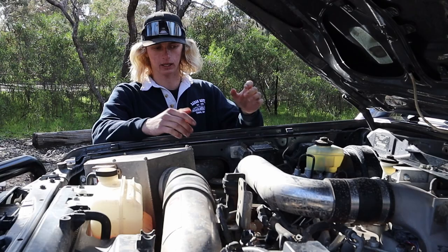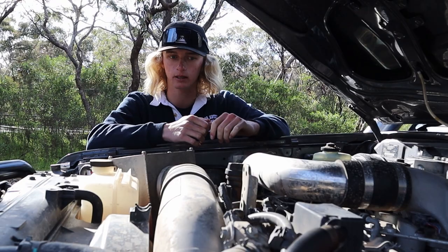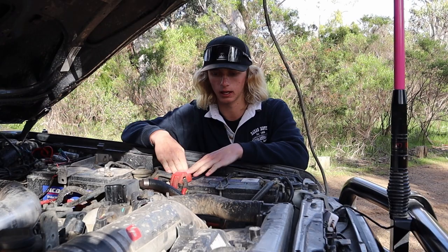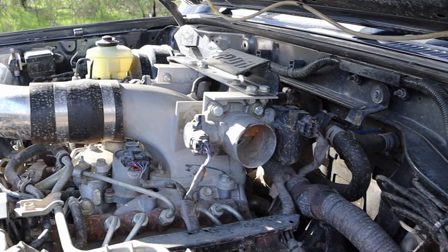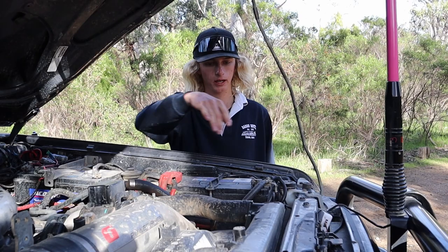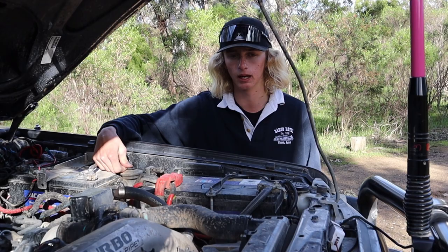It's running plus-70 injectors. The G-350 red wheel, which I've recently put in — it used to have the G-400 blue wheel but it was just a little bit too laggy and had a few issues with it, so going back down a size and it's still making good power. The reason we've gone front mount — the PDI front mount — just helps it run cooler. It's my personal opinion that on top it's going to be hotter, so good airflow through the front, not worried about any heat from the engine bay, no fans, just straight through — runs better. I tow a fair bit so it definitely makes a huge difference with the temps. Opens up the engine bay a bit more — really happy with that, definitely a big positive.